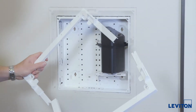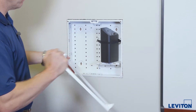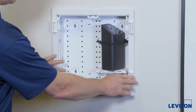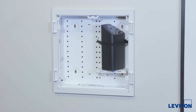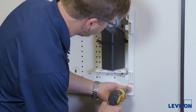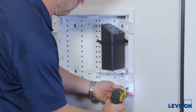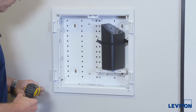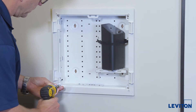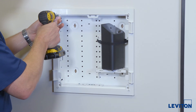We'll go ahead and install the plastic trim ring. First we assemble it, then drop it over the screws we left in place. Take the two screws that were removed previously and reinsert them, then snug them down. These don't need to be very tight — just enough so they're holding it without rattling. Tighten the top two screws as well.